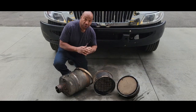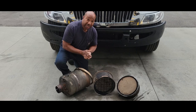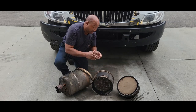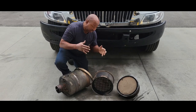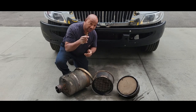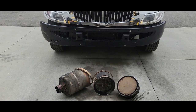That's all it takes to remove your system out of your truck. And if your laptop tells you that your DPF is full, chances are it's going to be your DOC. Now, keep in mind that if your DOC is cracked up — the honeycomb is cracked up — chances are you're going to have to replace it. But if it's not, like mine, I'm going to keep my fingers crossed and hope that the system can be cleaned. That's a whole lot cheaper and can get me by. Stay tuned for part two as we put the system back together and find out what caused this system to get clogged up — most likely it's probably the EGR port, which we will cover in part two. Take care and God bless.